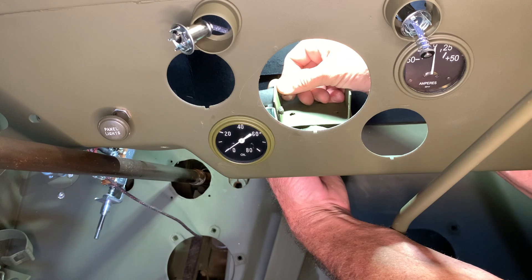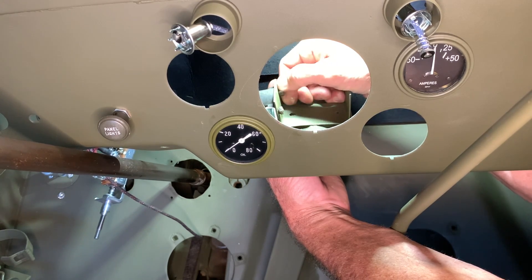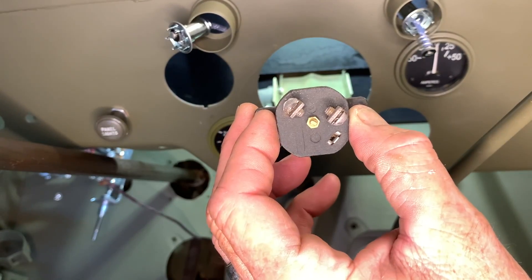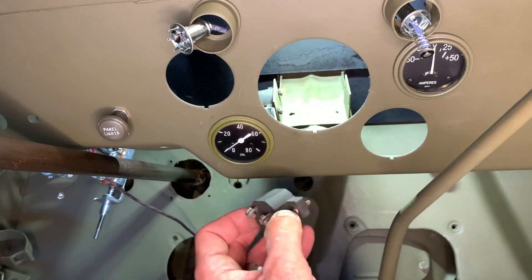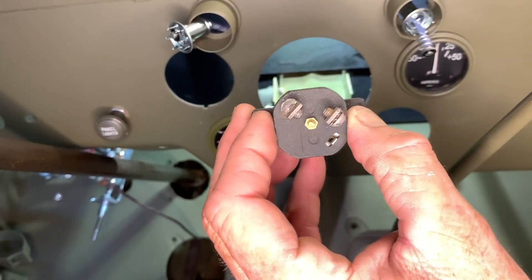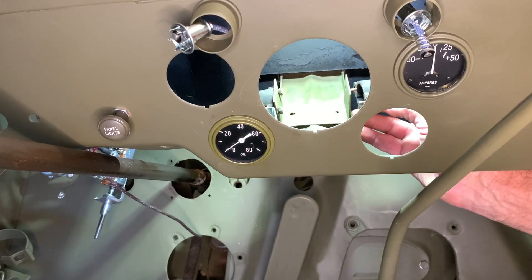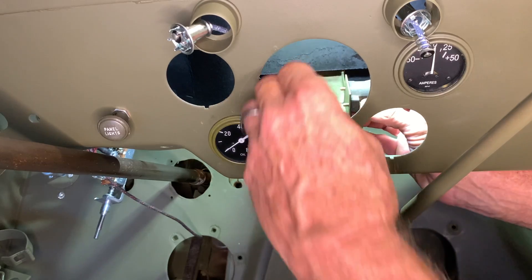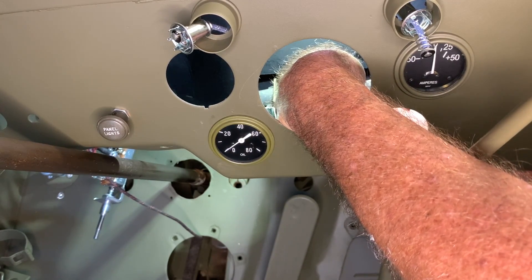I've got the other lock washer and nut set on the top screw, and I'll use a flat-head screwdriver and a small wrench to tighten both up. Now I'll move to the opposite side for the 20-amp breaker for the horn circuit, installed the same way. I'm facing the connectors upwards on both, and I'll show a picture of that towards the end of the video. We'll install it on the passenger side just as we did the driver side.